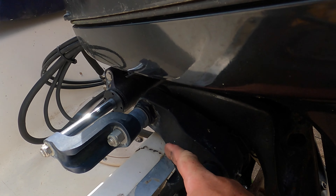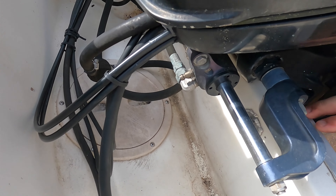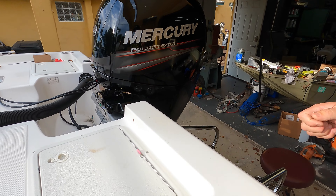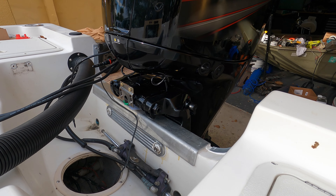If you've got just a regular big flat washer and you're bolting it on the transom, that's why I had to put a transom saver on this boat. Somebody had impacted it with an air impact wrench and it actually broke the fiberglass — it was sucked into the fiberglass and caused it to crack over time. Now I put the transom saver on — it's a transom plate that goes all the way across. That increases the surface area so you can torque it properly without causing damage.